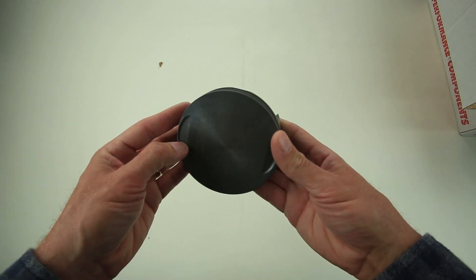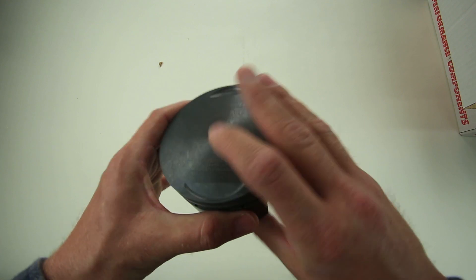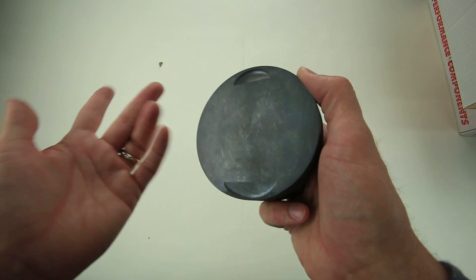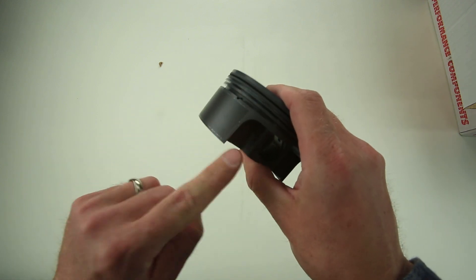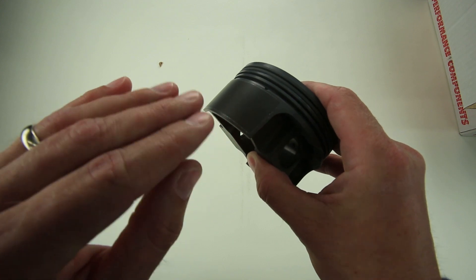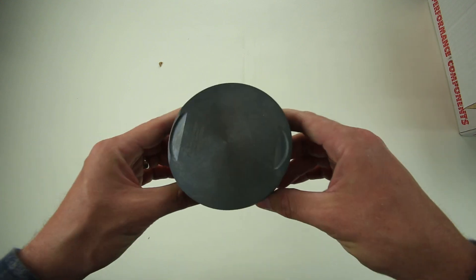You'll note it has a gray phosphate coating. This is not a thermal barrier or anti-friction surface — it's to reduce wear and also act as a slight lubricant. You can machine through this coating without worry of compromising it. You'll also see two other coatings: on both skirts there is a darker gray coating, known as a Graffal skirt coating, which is a friction reducer.